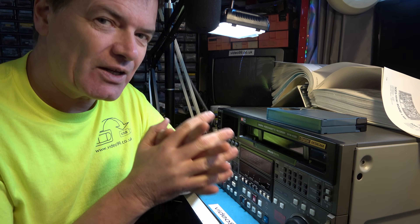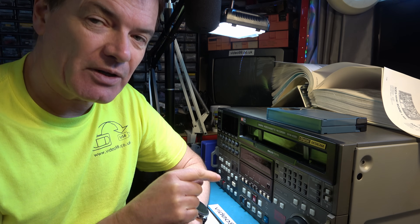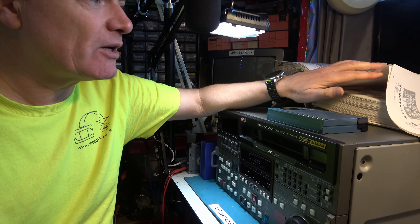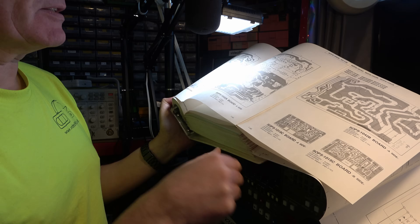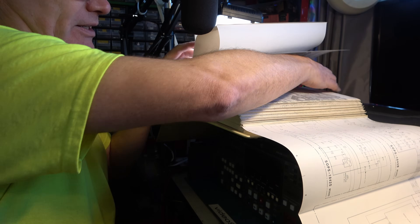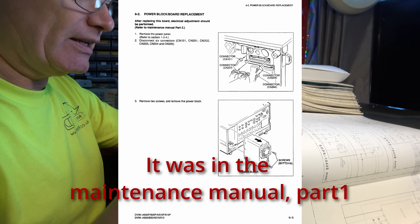We need to work out exactly what the voltage is for this because it's been used in the UK. It may be that the power supply has been swapped over for a 230 volt one. I do have the service manual for the PAL version, but I haven't managed to find a service manual for this NTSC one. So I think what we're going to do is just take a look at the power supply in here and see if we can work out what the proper supply voltage is for this machine. The service manual does help insofar as it tells us a little bit about the power supply that is in the PAL machine, but it doesn't tell us an awful lot about how to get to it. It may be that it's in a different part of the manual that I don't have, so I'm just going to have to take the lid off and have a look.